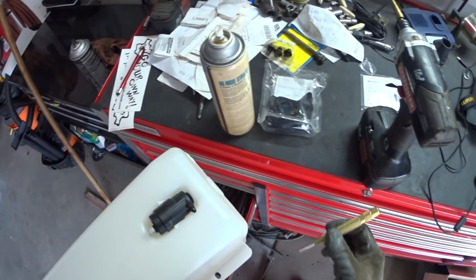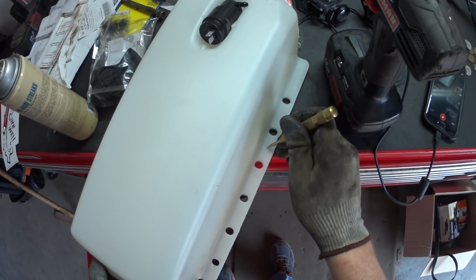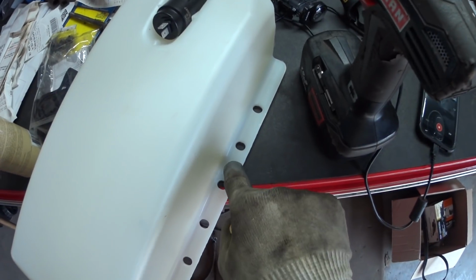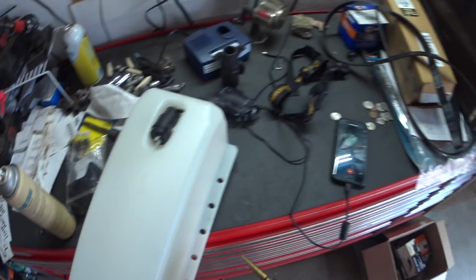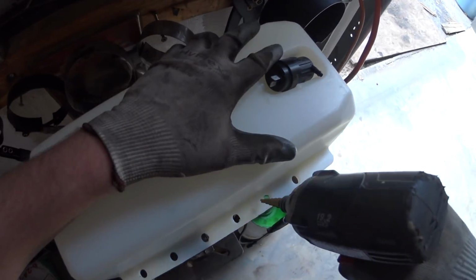Okay, so I like to do this no matter what I'm doing. Just put a little pilot hole there. We're going to just take that and depress it down. And that gives us a little divot to start our bit. And I don't have a bit in my drill press, but this unibit will suffice. I'm just going to stick it over here on this vise as a bridge.